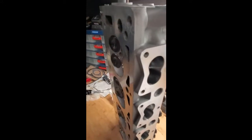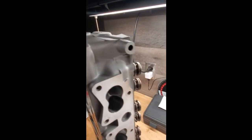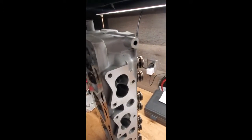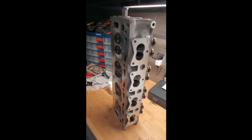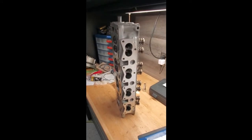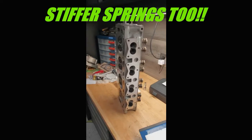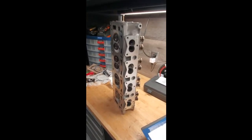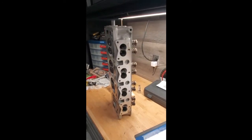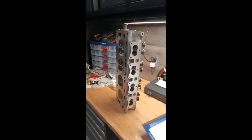Here's the head. When I got it back from the machine shop they put the blanking plugs back in. While it was in there I had the exhaust ported — not polished, but worked through a series of finer and finer grits for good flow. All the valves are new — both exhaust and intake — sitting on new valve seats with stems measured and cut correctly. I also went with the Sport 300 valves, hoping to get a little extra performance.